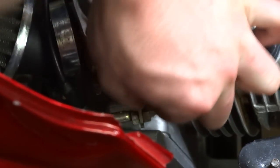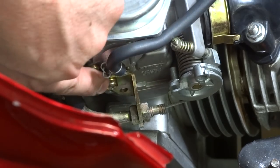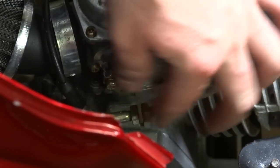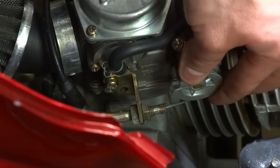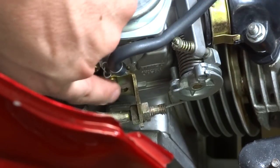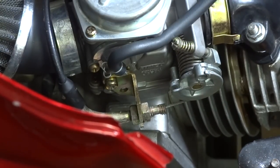I got it straight down and it's really on there — there's no way it's coming off. If that comes off the whole carburetor is coming off with it. You just leave the top one in, and once you get it straight and lined up you put your cable in there, adjust your nuts where they need to go so that the throttle opens up all the way and closes all the way, then tighten that top one. And that's pretty much how you do it.